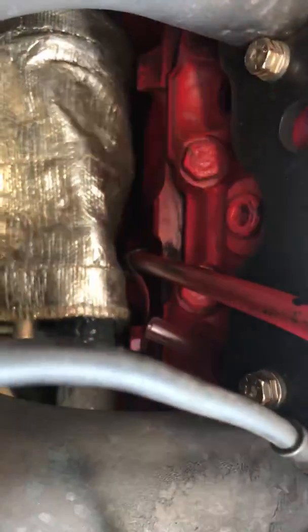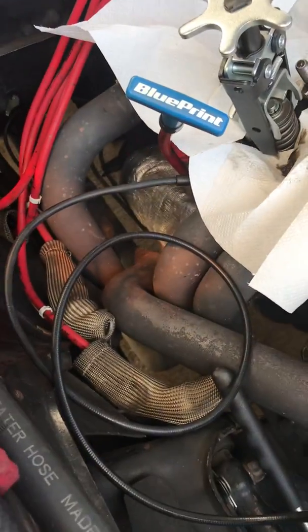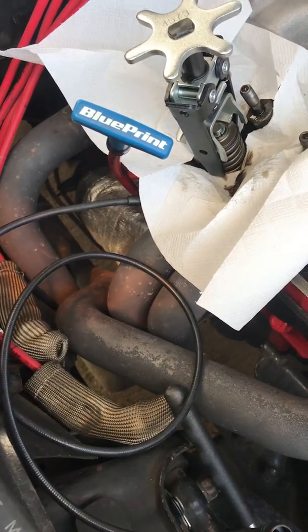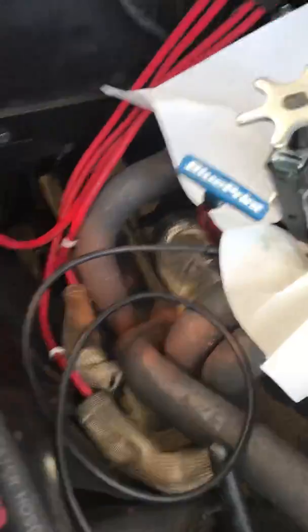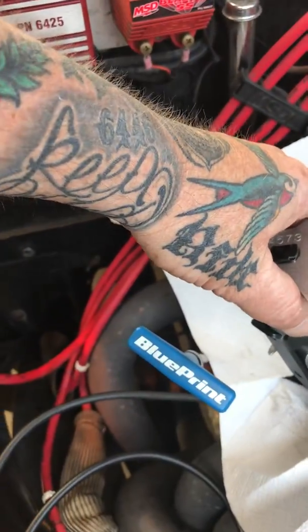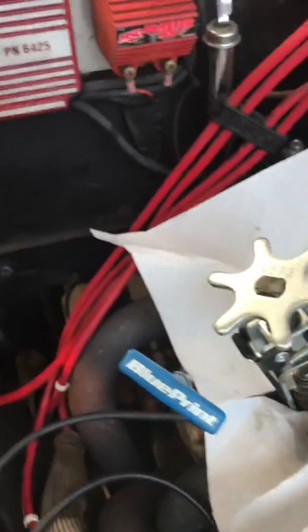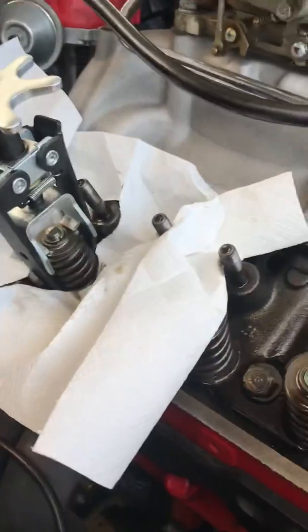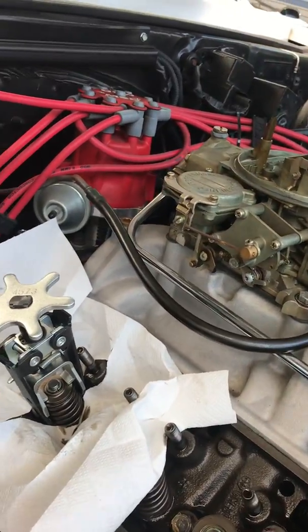You want to start off at bottom dead center — piston at the bottom of the cylinder. There's a tube sticking out of the spark plug hole. I use about one meter long of flexible plastic tube. Some people use rope — it's called the rope trick. When it's at bottom dead center, you jam it all in there, then turn the crank by hand to feel the tension. That way you won't drop your valve, because if you drop your valve in there, you're screwed.